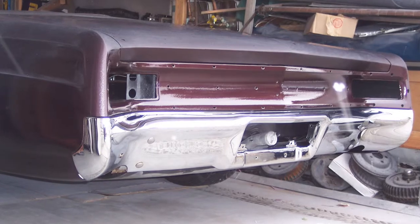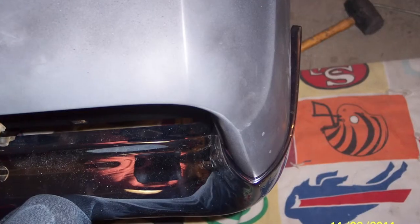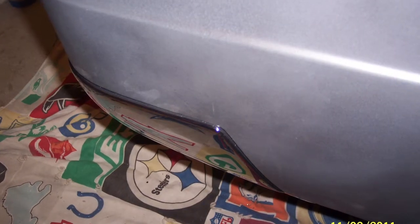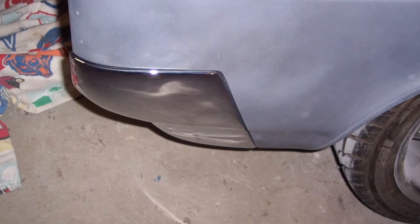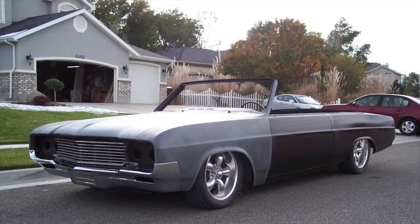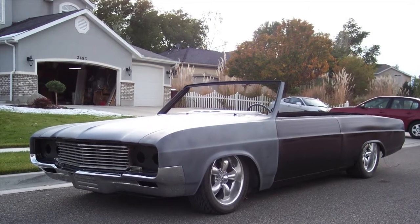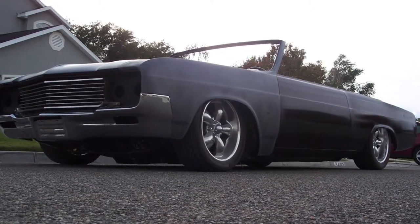It was pretty amazing that I was able to get that to fit again. The front bumper — I wasn't so successful. The edges were out from the originally manufactured shape, and to pull those in where the V-shape was at the tops of the fenders, I ended up cracking the chrome. It's tucked underneath the fenders, so I took the chance — I dabbed in some silver paint underneath the cracks and coated it as much as possible. I got a hold of my chrome guy and he said they will re-chrome them if there are any issues, so I'll leave them and make sure I don't have any other issues.